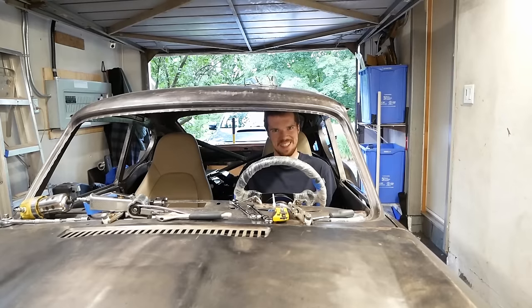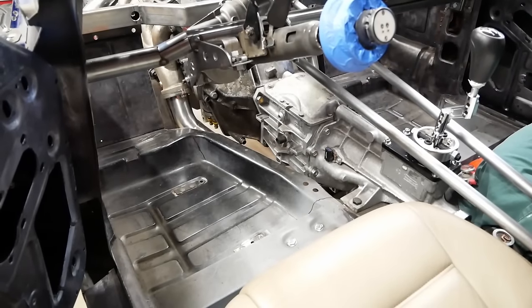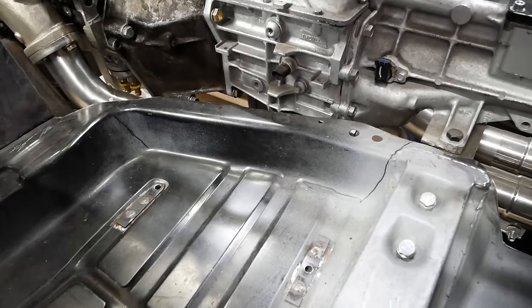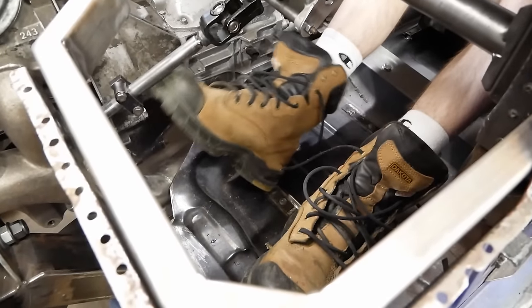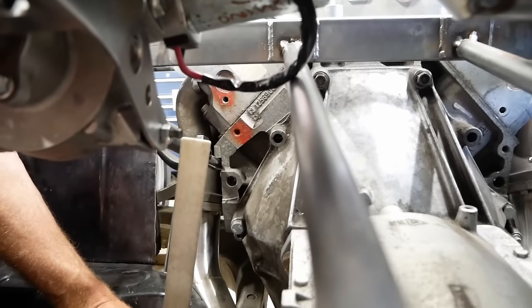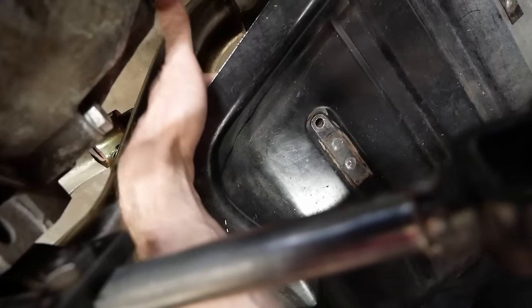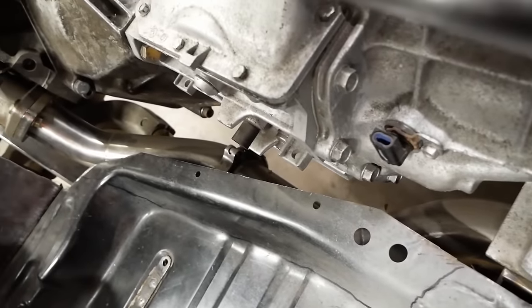Yeah. Thanks, Leyland. It's not exactly nice for the old spine, then, and if we can correct this, it's important to do so now, as the throttle will set up the position for the other two pedals, and consequently, we need to start with it. A ruler helps to show where this lip is pointing, and happily there's plenty of clearance to the transmission and exhaust to reclaim, so in following with the rest of the floor, let's fire up the grinder.